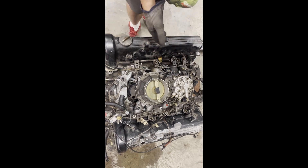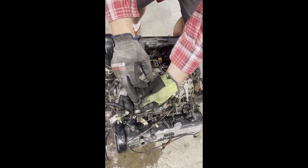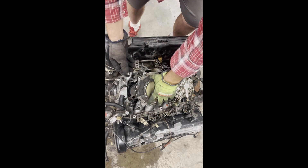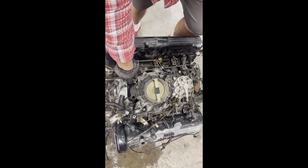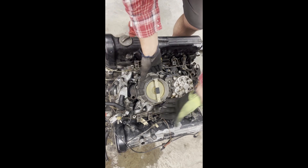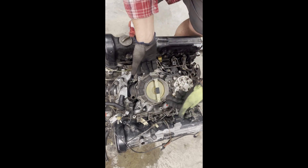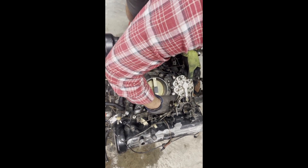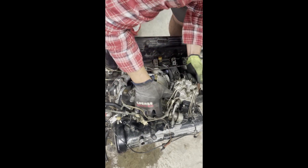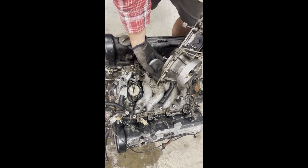I forgot to hit record so I actually already got this loose. These things always end up sticking — ripping off. These are the isolators for the whole fuel plenum. Once you have all four bolts removed, that's all that holds it. There's a little clamp down here — once you get rid of that, the rear part moves a little easier. Just grab underneath both parts and yank upward, paying attention to the throttle linkage and fuel lines. I already did pop it — it's just force.